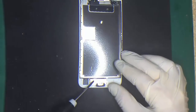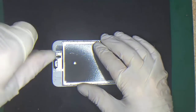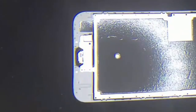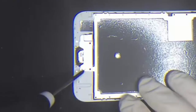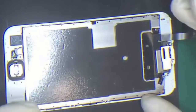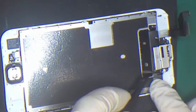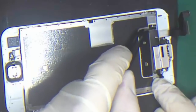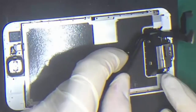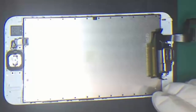These are all Phillips head — it's very easy. At the bottom there are three screws, and we take off that plate holding down the home button. Now watch carefully — I flipped the actual back frame off, but look at the top, you'll see there are these two black tabs. You just need to peel them off — real easy, they pop off. And then the whole back plate comes off so easily. This is a really, really easy model to fix for the iPhone.